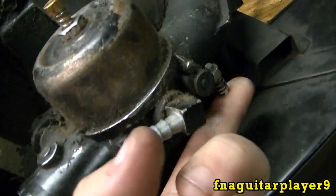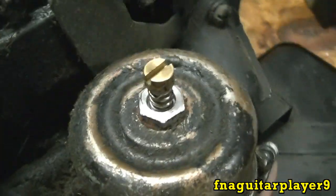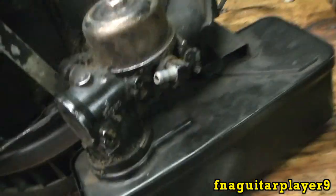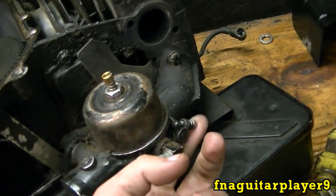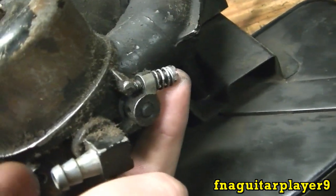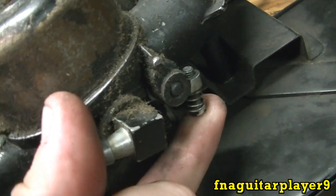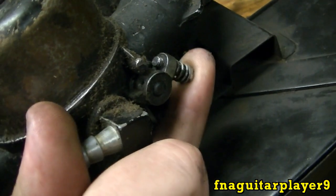This is your actual throttle plate — it opens and closes the valve inside the carburetor, controlling how much air and fuel gets to the cylinder, which controls the RPMs. This position here would be idle, and that screw is your idle speed adjustment. Most small engines idle at 1800 RPM. And this is wide open throttle. These engines are governed at approximately 3600 RPM.